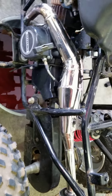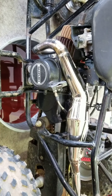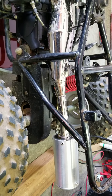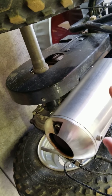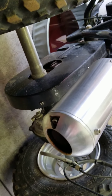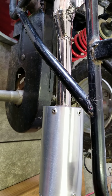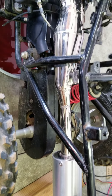Taking a closer look while I have it apart, here is the CT Racing pipe — it's the header expansion chamber and the exhaust comes with it. The exhaust is nice. It does have some screws here and here to pull it apart so you can repack it, which is great versus just having pop rivets. Having those screws means you're not having to drill them out each time, and that's always a pain.